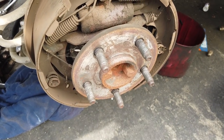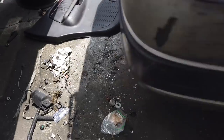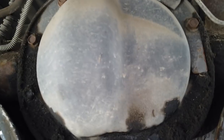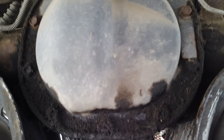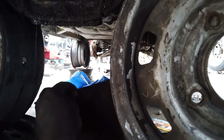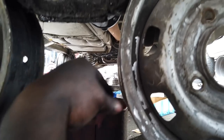Now we get underneath here and start to let the axle loose. You've got to crawl under here, and if you're afraid of getting dirty in the yard, it's probably not the hustle for you. This is the diff — smaller than the 8.8 but it's got the same size axles. One thing you want to do so you don't cause a mess is get some sort of receptacle to catch the oil, because this oil stinks and you don't want it on you.